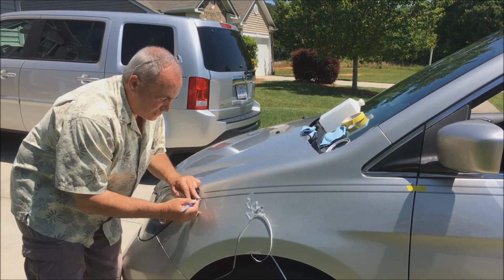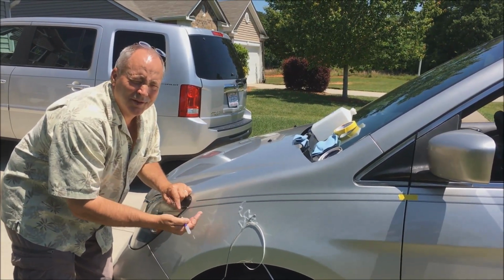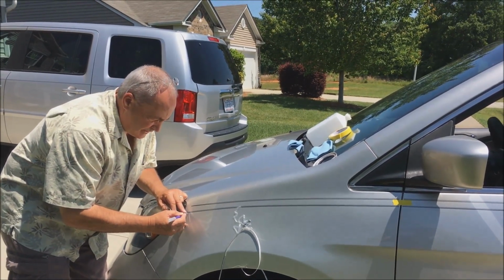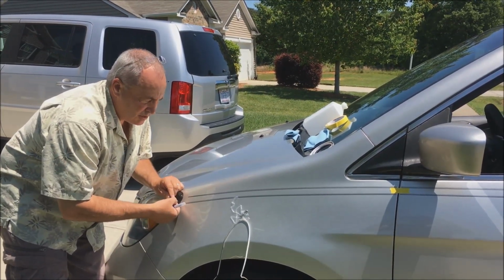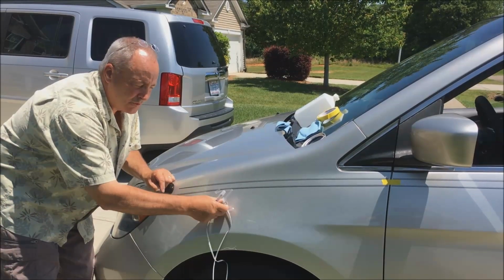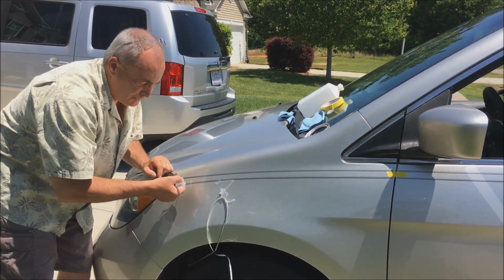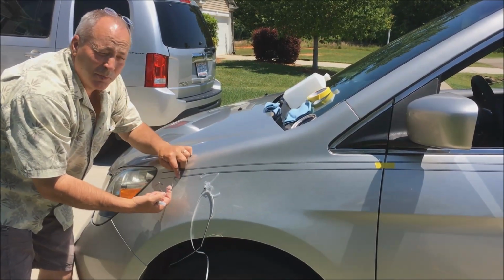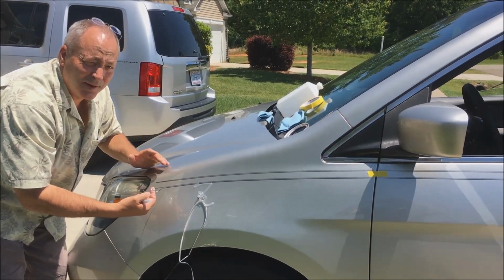The easiest way to do this is just figure out where you want to end it. Usually about 1 inch from the front is what I do. And then you make a click and a cut on the top stripe. Okay, then you don't pull the backing, the clear carrier, all the way off. You leave it on for this part, and you gently tease back the stripe. It's going to be just pulling back the bottom stripe because you want this one as your kind of base.